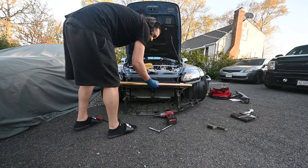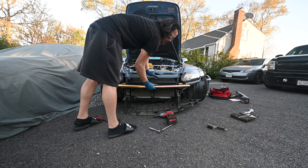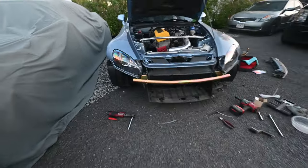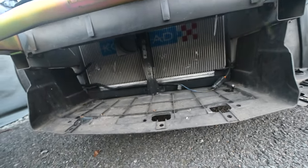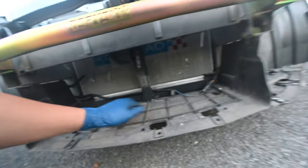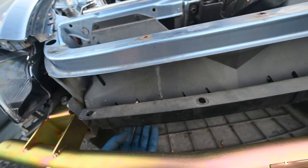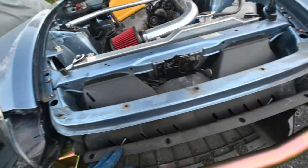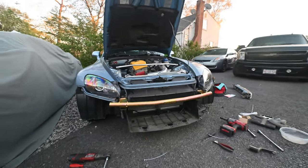We got the new bar, and it's just going to slide in and place over the old one — like so. There's a little extra space in the opening to slide it on, which makes it easier. Once you tighten the bolts down, it'll clamp down and hold in place. The bar is on, the 14s have been tightened, and I took the opportunity to replace some of the broken clips on the bottom side. I still need to get new clips and the splash guard for the passenger side. For the air diverter, I zip-tied it back to the stiffener, just so it wouldn't rattle against the metal bar causing an annoying sound — since I have the Innovative mounts at 85A, the car vibrates a good bit. But other than that, it's time to throw the bumper cover back on and hide this pretty piece.